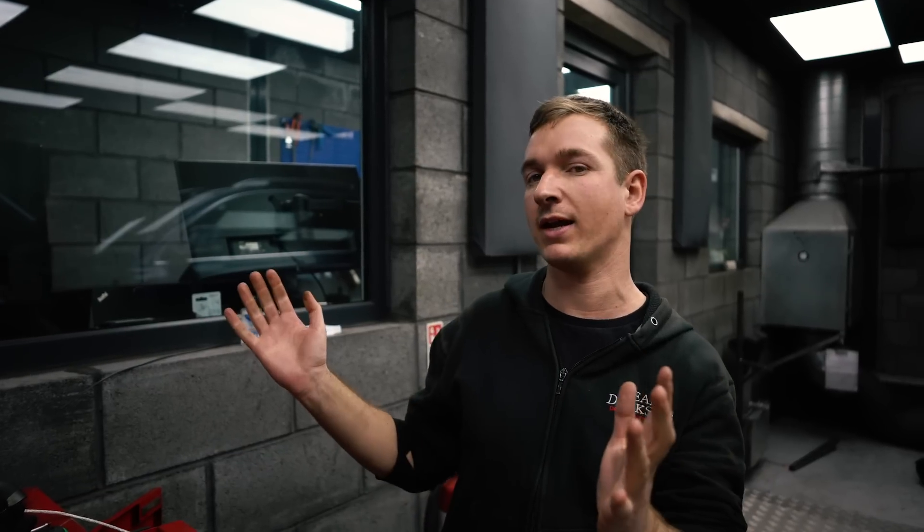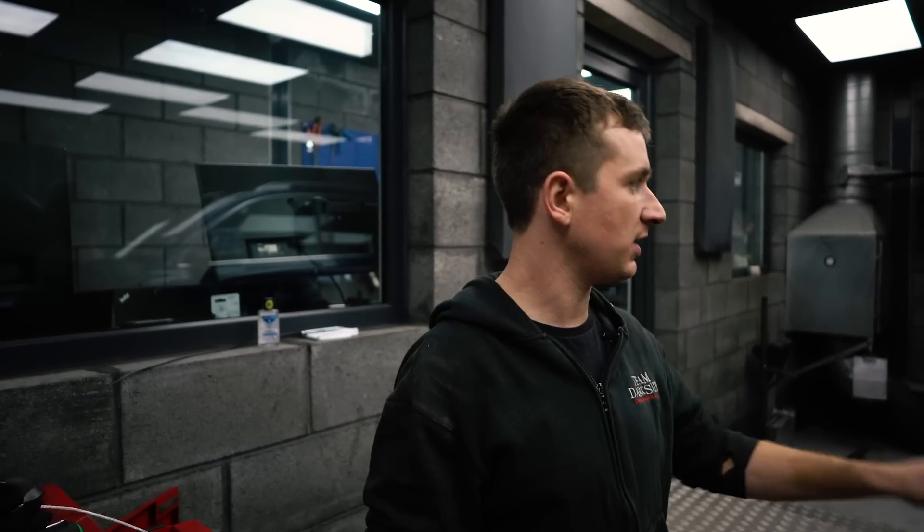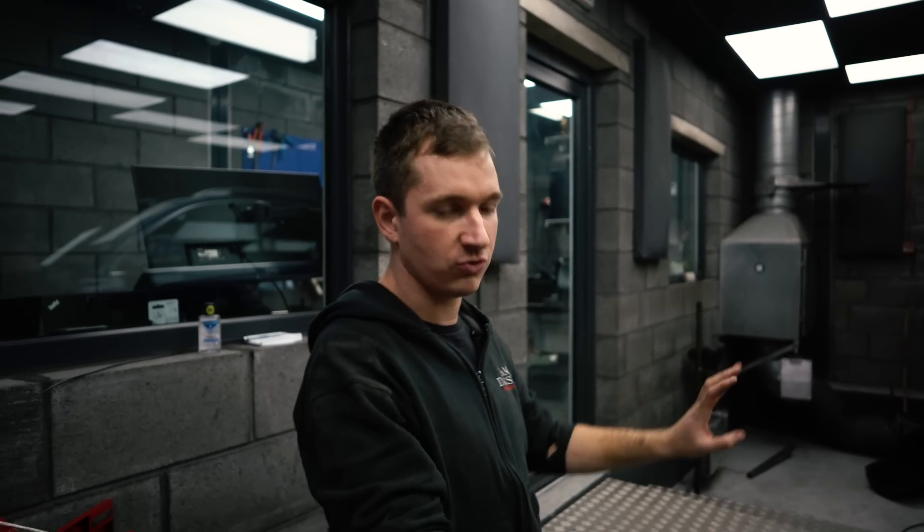Not exactly where we want it to be. Looking at the curves, the tune it came in on was like an R50-style tune, so there's not tons more to be gained out of it. They should be 340 or whatever — so about 20 horsepower gained, but I'd like to be sort of 40 horsepower. These are old now, and pushing them to their limits is where you're going to start popping things, and nobody wants to change the turbos on these. We'll get it off the dyno and get into the fab shop.